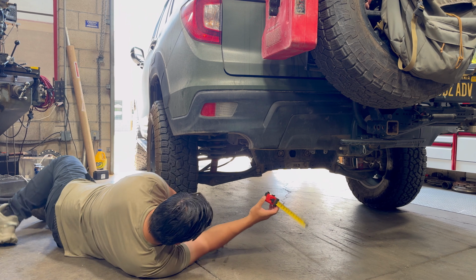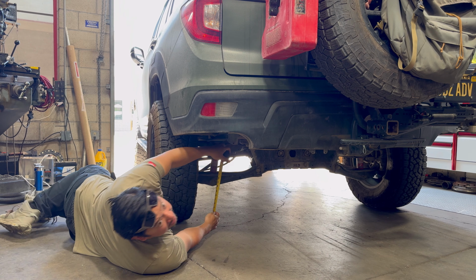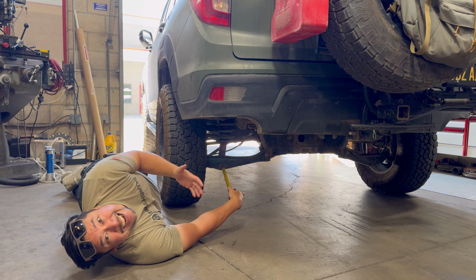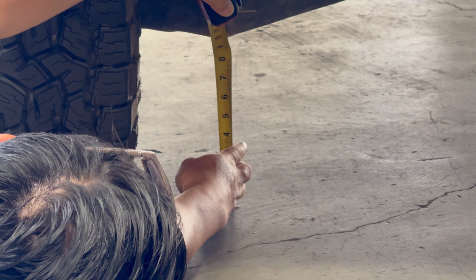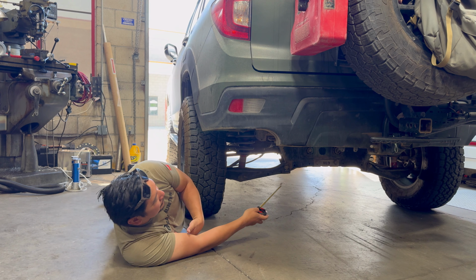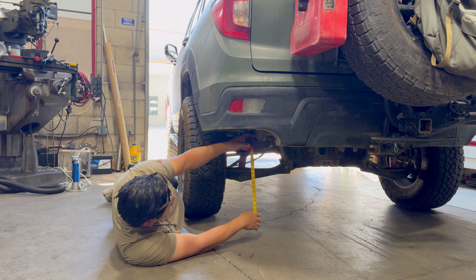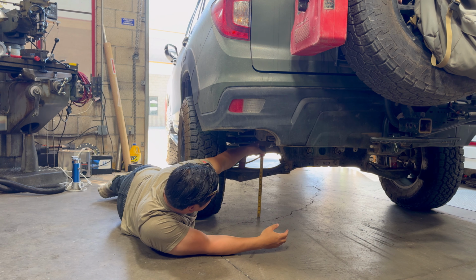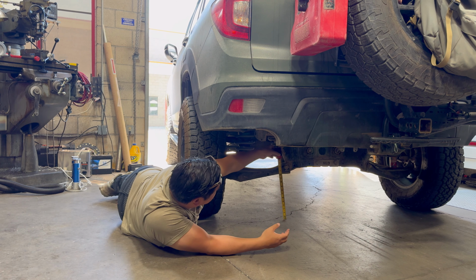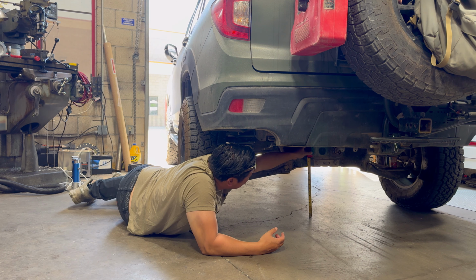Anyways, camera's running. Just gonna show people that, because I'm now running the 33-inch tire, this is just over this lowest point right here. I just measured it, 9.5 inches. Yeah, just leveled with it. It's basically the same clearance as a Toyota Tacoma's rear diff, right? 9.5 or Yeah. 4Runner's rear diff. Now, if we go to mid shaft right here, that is still 10.5 inches. And right there, this is 12 inches. And right here, that's 13.75 inches.